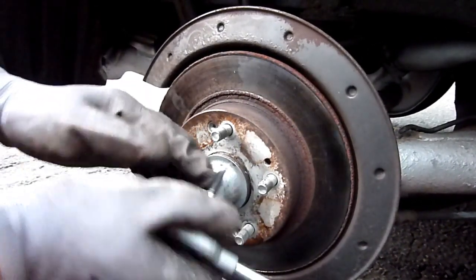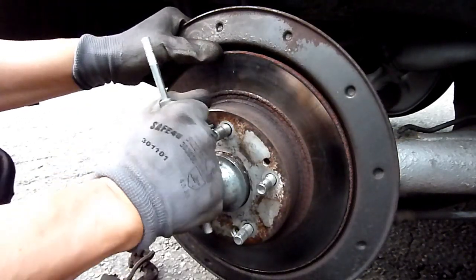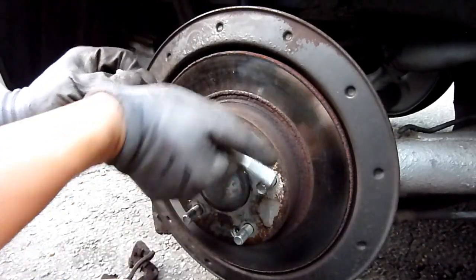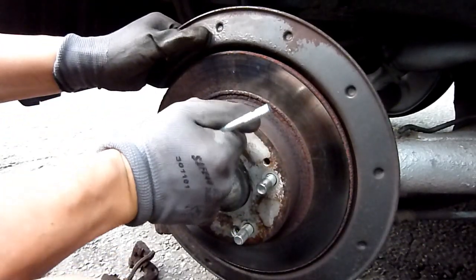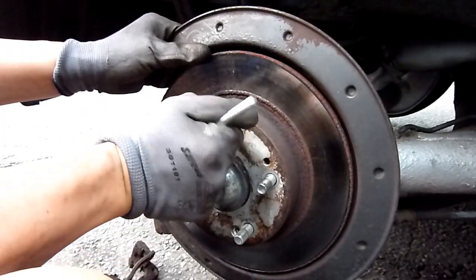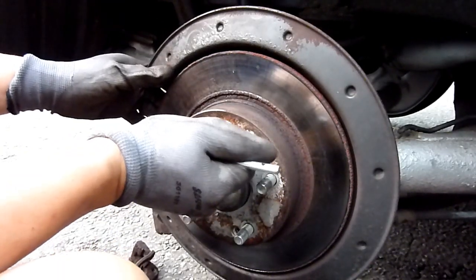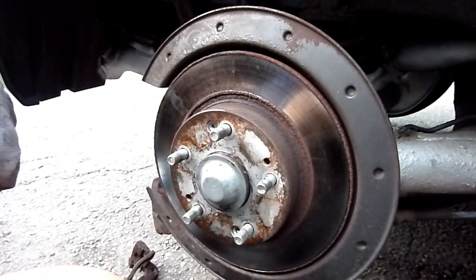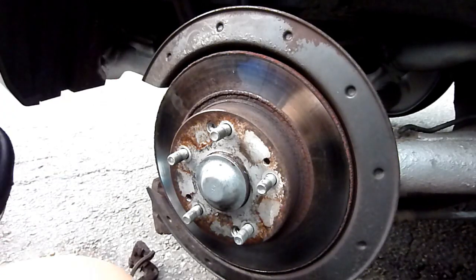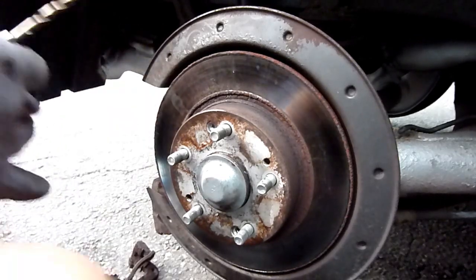See if I can get the tip of that extractor in there first before it gets a grip. No — as soon as it grips it might turn it. We need a vise or pliers to take it off if it does grip. The outer hole needs to be bigger while the inner hole stays the same — I'll drill again now.